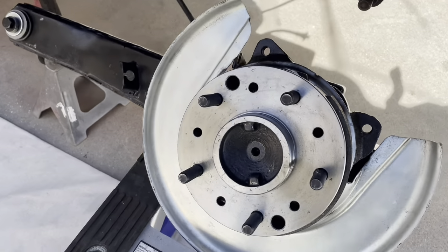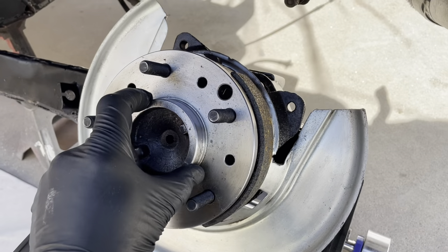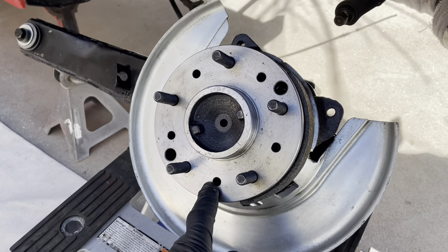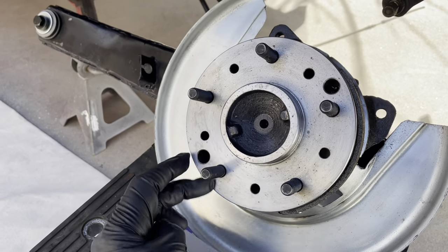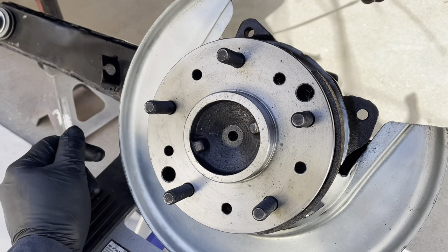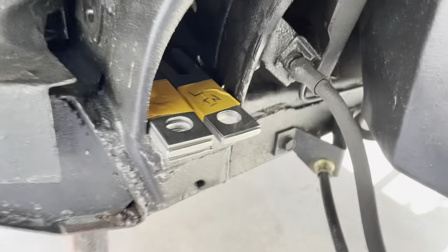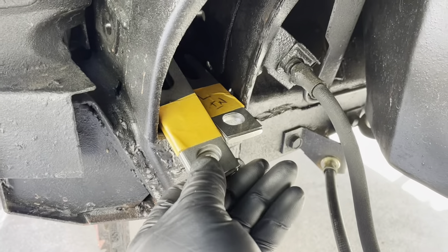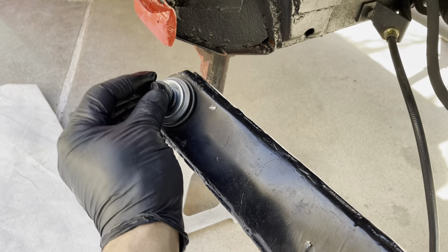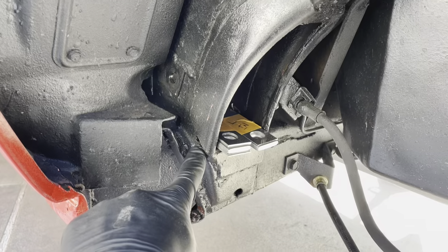Here is my rebuilt trailing arm. I did have to get a replacement spindle, which kind of sucks — I asked the guy to put a GM one in but I think this is a newer third-party one, which is okay. I destroyed the other one being sloppy trying to get it out. I've got my new spacers marked and sitting here. The goal is to get this in — there's a bolt here that goes through up here, and then there's a big cotter pin that goes there.